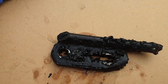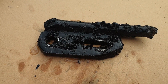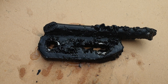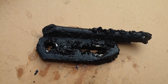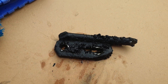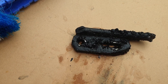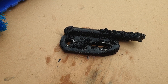You can see the bubbling on the other half of the bracket — I just sprayed that while I was brushing the first piece in the bucket of water. It's only been maybe two or three minutes and it's already bubbling. So as you can see, you don't need to get your parts sandblasted or sit there for hours with wet and dry — just get some gasket stripper.